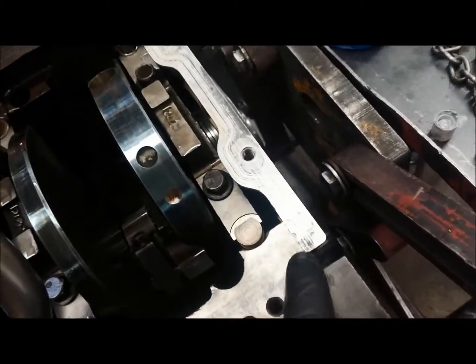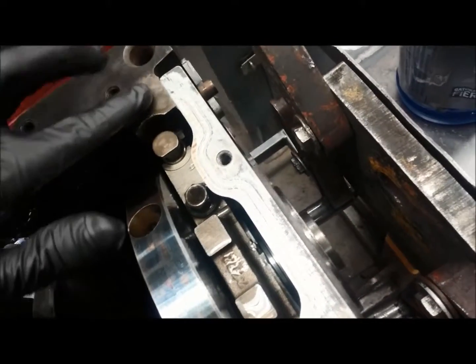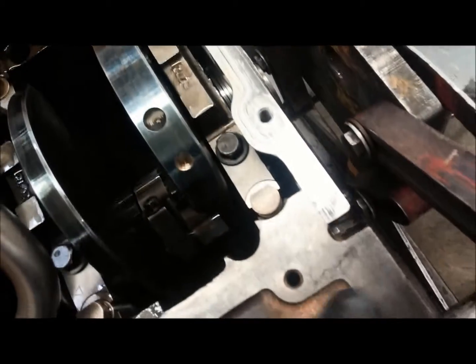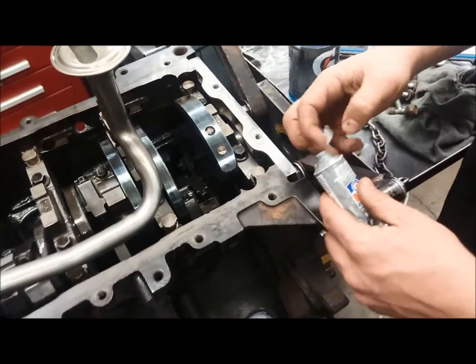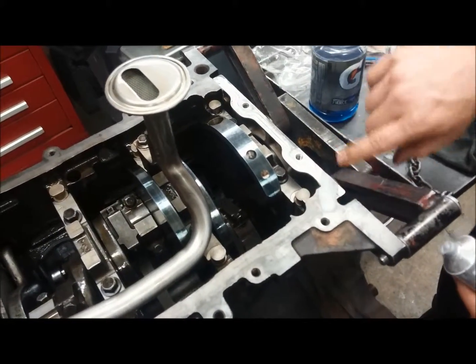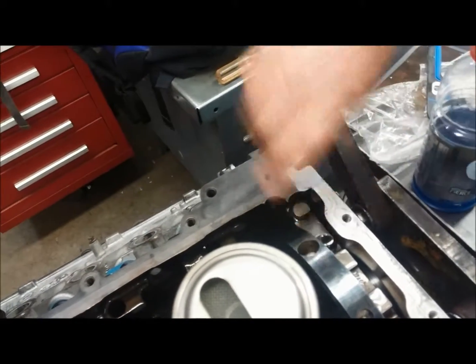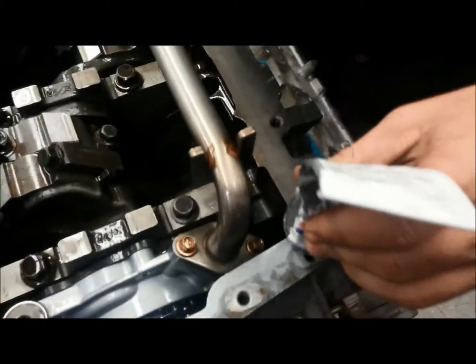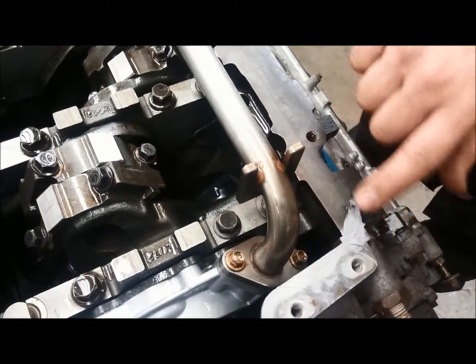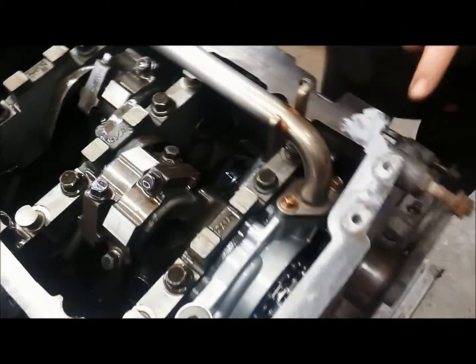Come back over here to the back and you see the same thing happens here where this cover with the rear main seal fits on, right where it bolts to it. This gasket is going to sit over the top of this and we just want to apply a little bit of silicone on those seams — just a very thin, small amount on the seam there. As always when using silicone, don't get carried away because it'll squeeze out and some of it will squeeze into the engine itself, and we don't want that to happen. So make sure it's thin — just a tiny dab will do.